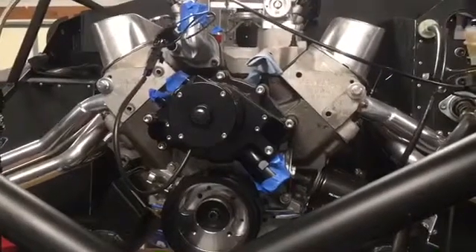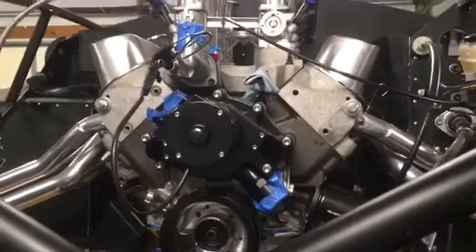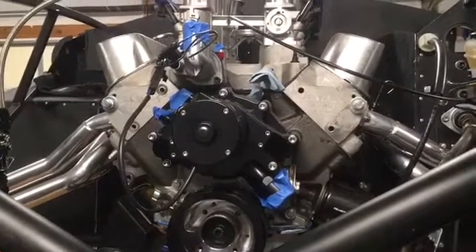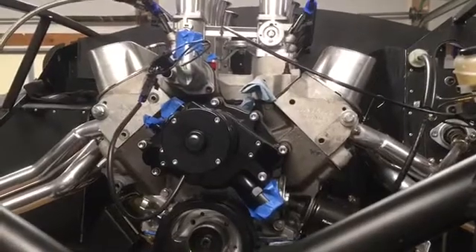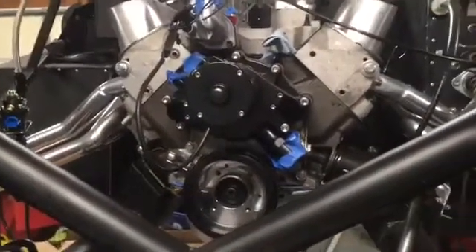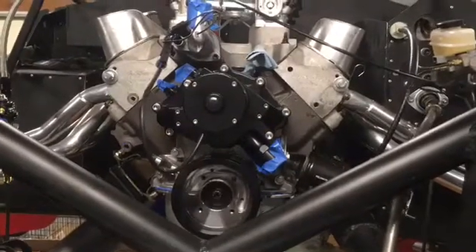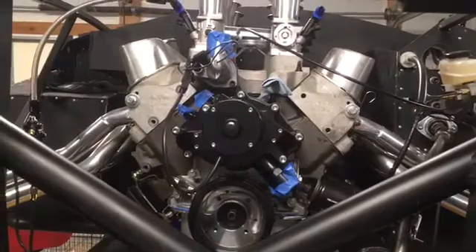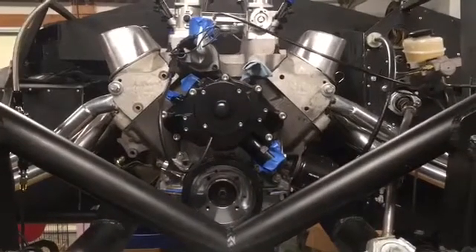If I had gone a different direction — trying to build a high-revving 302 doing 7,500 to 9,000 RPM — I would want a different ignition solution, whether a more exotic distributor setup or individual coil-on-plug with a cam sensor, like LS1 coils, which some people have done even on Fords. eDIS is dated now, but it's still a really good quality OEM ignition setup. Depending on what you're going for, it gets rid of some of the headaches of distributors and it's easy to set up and tune with the right controller. Thanks for watching — like, subscribe, leave comments, and see you soon.